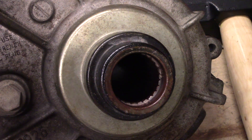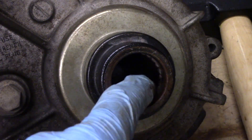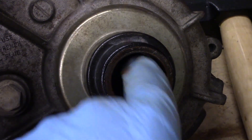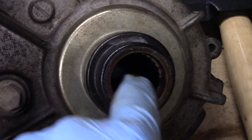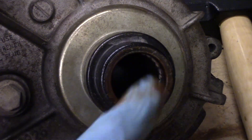The reason this happened is that when you put the transfer case in gear, it engages both drive shafts. The thing that keeps them from turning is your foot on the brake until you let it go — then the drive shafts start to turn and you start to move. With the teeth on this gear completely gone, this gear in here wants to turn because the engine's moving and everything's engaged, but everything was stripped. So that was the grinding we were hearing.